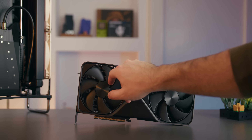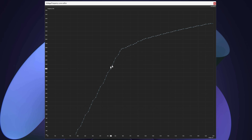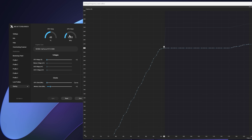Let's take a minute to define what undervolting is. Simply put, undervolting means running the card at a lower maximum voltage compared to its stock out-of-the-box configuration. If we take a quick look at the voltage frequency curve of the 5090 Founders Edition, we can see how the core frequency goes up with each voltage step. In a real-world scenario, the GPU will boost frequency according to this curve until it reaches either a power limit or a thermal limit. So what we can do is flatten the curve past a certain voltage point, practically introducing a maximum voltage limit. We could stop there, but as you can see from the steepness of the stock 5090 curve, we'd be running at a significantly lower frequency, leading to decreased performance — pretty counterproductive.